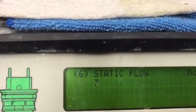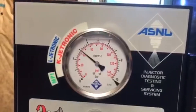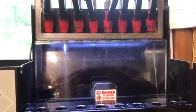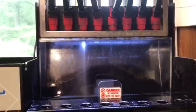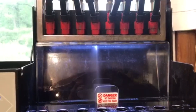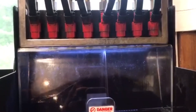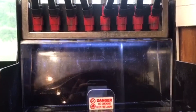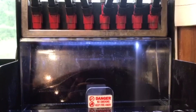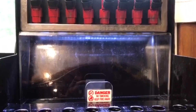This video shows the initial testing of my injectors. The initial sprays on the first three or four look good, but once you get to the fifth one, you can see it's a lot narrower. The sixth one is weak as well. Then one looks pretty good, and the last one is weak again.